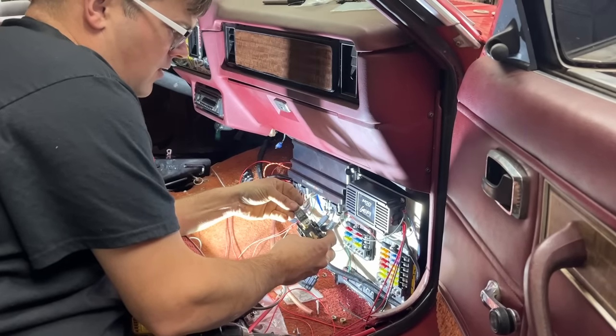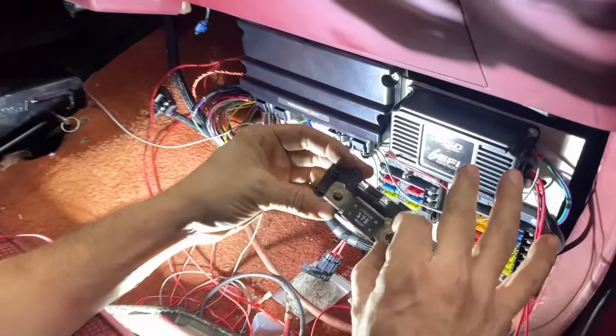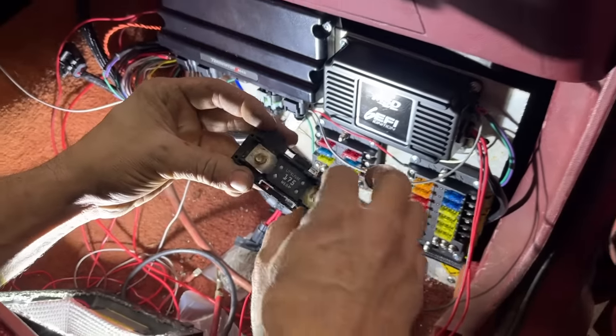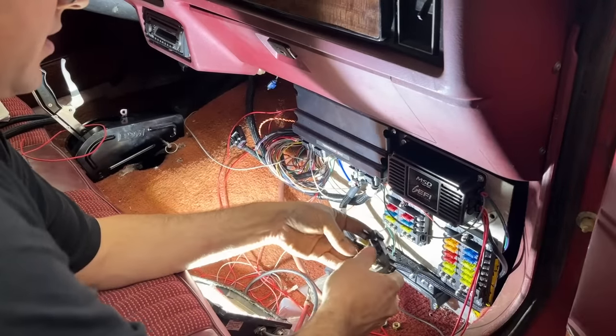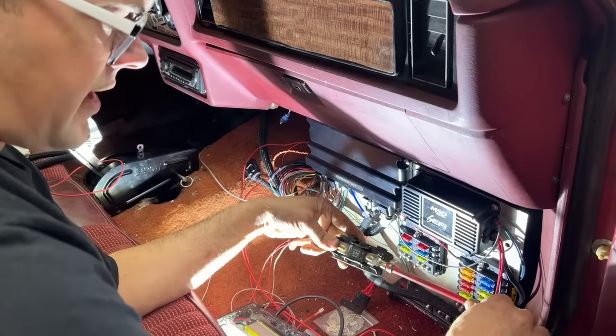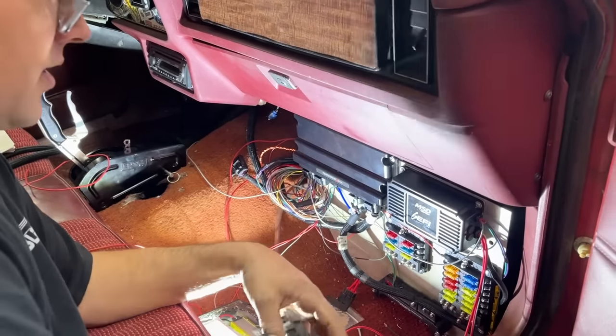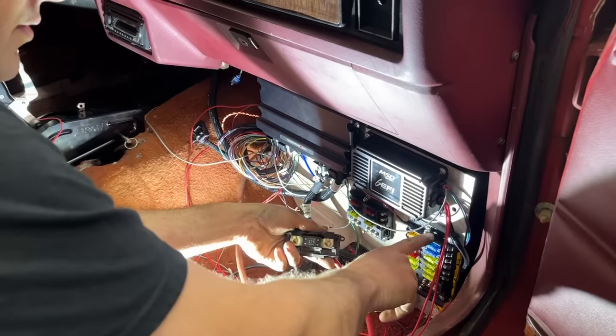While digging through all that wiring, I found this big mega fuse here, which is like a main power supply junction block that newer cars use. I'm sure I got it off some totaled car. So I'm gonna use it as a distribution block here. And we're gonna do our main 2 gauge cable into it. And on the other side, I got this 4 gauge cable that we're gonna go off from it to the solid state relay, and we'll run some smaller cables up to these two.